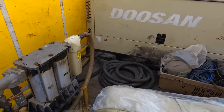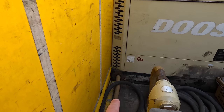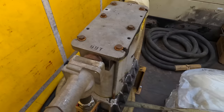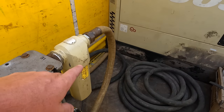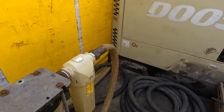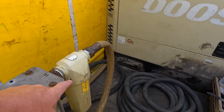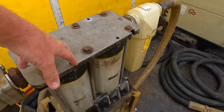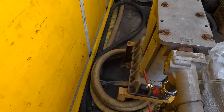So I've come from the compressor. I put that lead on there, that's off my old blast, well, off my blast pot. It comes up here, goes into its water trap. So then it's going to filter its water, filter the air from the cooler. It gets cooled in the cooler, and then it pumps its air through here. That separates water, so it's like a first water trap. This is a water and oil trap and a separator for particles. You can do a bit of research on them.